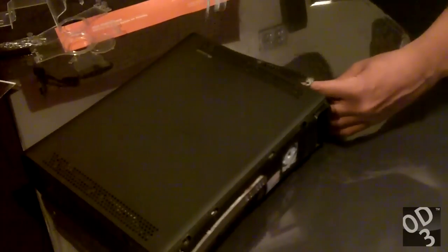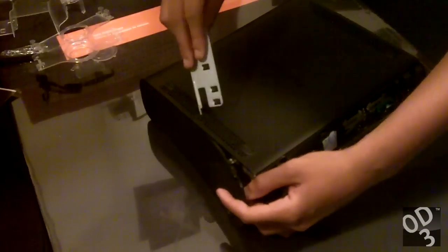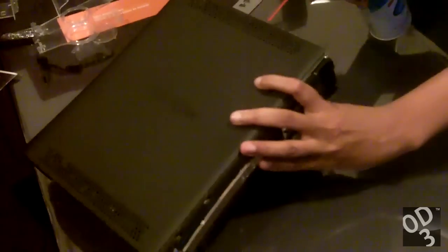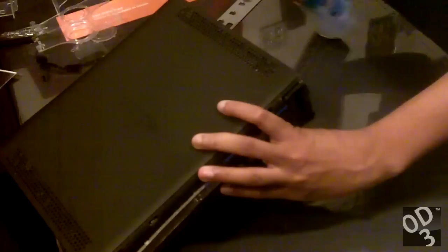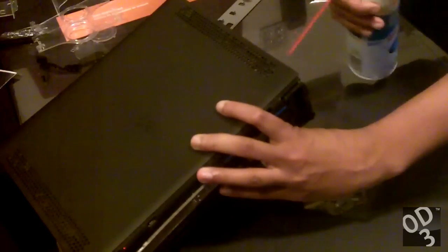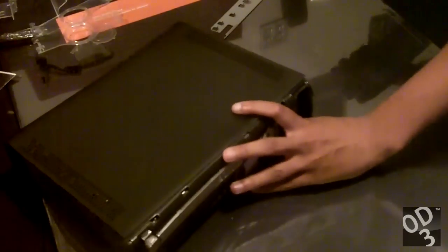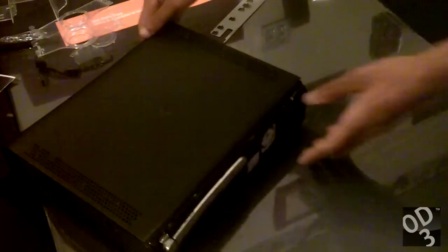The Legacy has a 12-volt nitro switch, which allows it to feed off of the DVD drive in the Xbox 360's power output, which gives out 12 volts. This in return makes the fan spin faster, thus moving more air. But in this installation, I'm not able to utilize that feature because the LED lights that come with the case feed off of the DVD drive too, and there's no adapter that allows it to feed out to two different ports from that DVD drive power output.